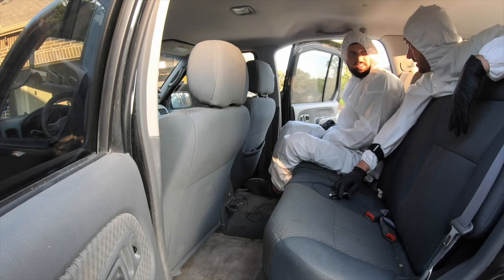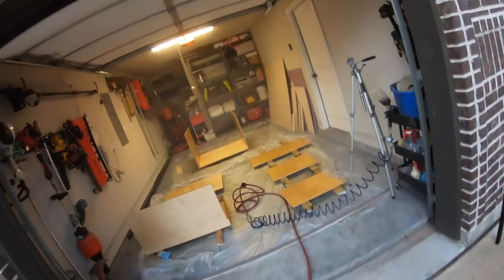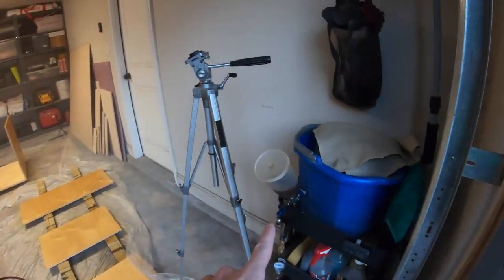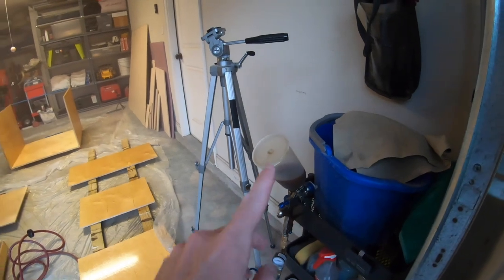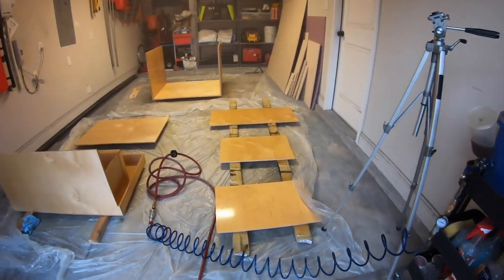So that's that. Funny story, I did once have a paint suit, actually two of them that I probably should have used for this, but Alan and I just did dumb stuff with them. But anyway, spraying the urethane full strength through the primer gun was not a problem at all. The gun did great, had it set to 20 PSI, I think, and everything came out really nicely.